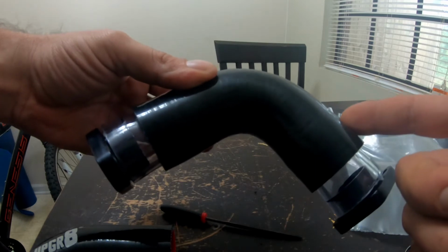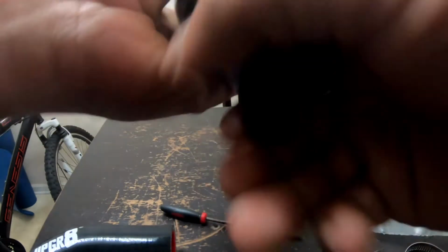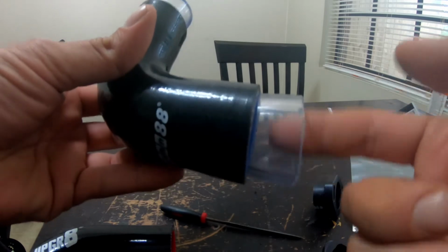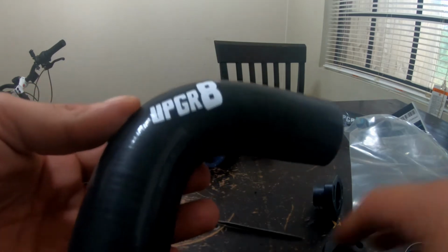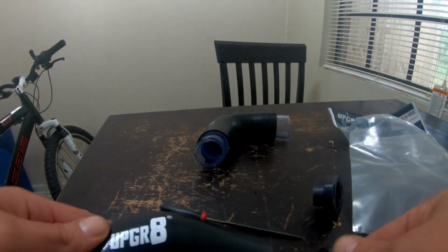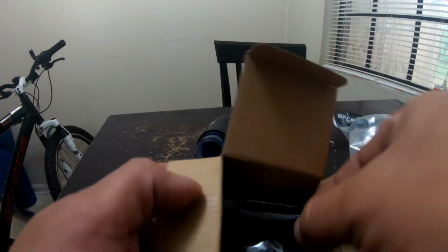And I ordered the wrong pipe. It was 1.5 inches. So, I had to get 1.25 inches. And now I want to use a standard vinyl because I don't think the gas and air is going to do well for it. So, I ordered this from Amazon. 1.25 inches is what that Mikuni adapter is going to be. So, ordered this. Go to Power Sports. Ordered the 65mm in length.